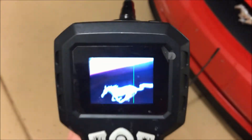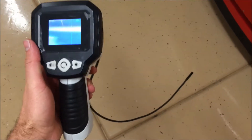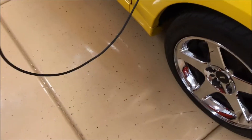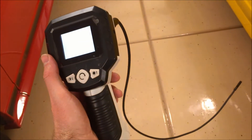These borescope tools are great for diagnosing down into the cylinders. We picked this up at Costco for around 50 bucks, and it has a little camera on the end of it so you can get real up close and look down into those cylinders to see what's going on. That's probably the next step I'd recommend if you do notice that you have low compression in any of your cylinders.